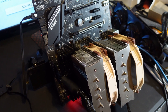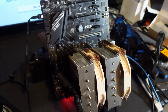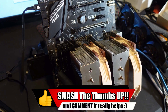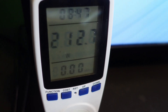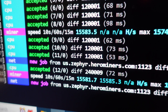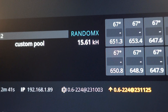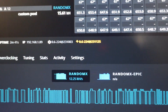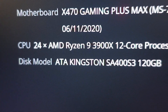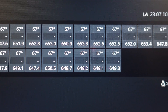I can't remember exactly what I hit before at 15,300 hashes, but right now we're at 4.25GHz. Go to the comment section and let me know if we beat my previous record of 15.3 kilohash. We're currently at about 213 watts and our hash rate is 15.5 kilohash, with a high of 15.7 kilohash on the Ryzen 9 3900X. Hive OS is showing 15.6 kilohash and our temps are still only 67 degrees - this cooler is absolute beast mode. We beat my old record!